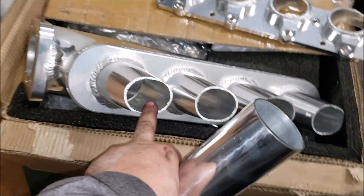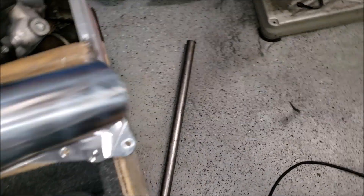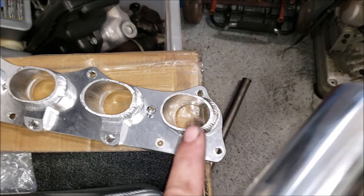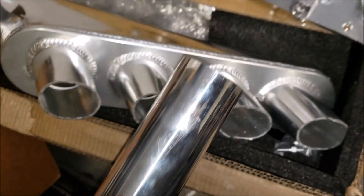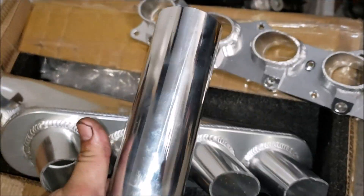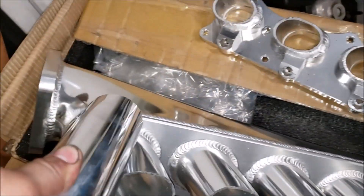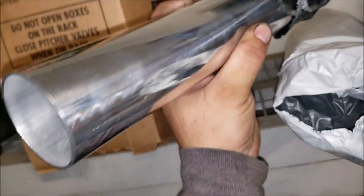For the intake manifold, we finally decided: we purchased two-and-a-quarter inch aluminum tubing, the same gauge as our runners. It's slightly oblong but the same size. We'll measure what we need — about seven and a half inches from port to tank — cut them flat, and flare them out to two and a half inches. Sharp Customs does the same type of flare but angled; we want to run straight. We'll weld it up — cheap alternative, about 20 bucks in tubing.